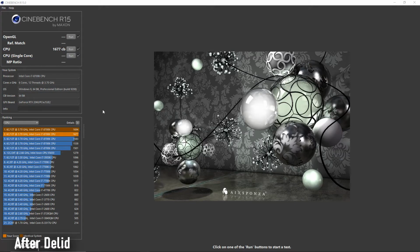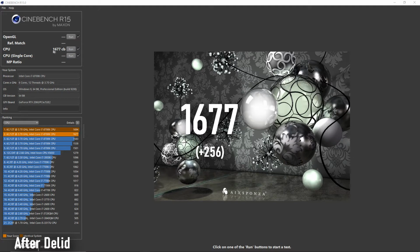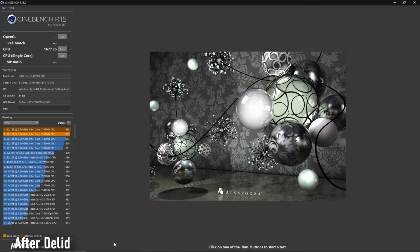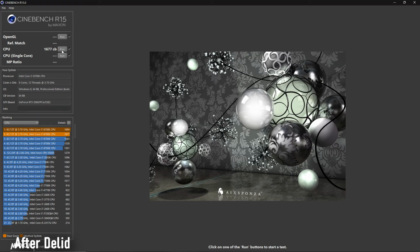Alright, so to end this video, my score after the 5.1 gigahertz overclock is 1677. My high score was at 5 gigahertz with 1694. I did that with less faults, so maybe on 5 gigahertz I can even manage to get a higher score than on 5.1, but I'm not gonna bother to do all of that because this is only Cinebench, so it goes deeper than that. Now, as for the temps, I'm gonna run Cinebench again with high priority while recording, and having HWiNFO open.